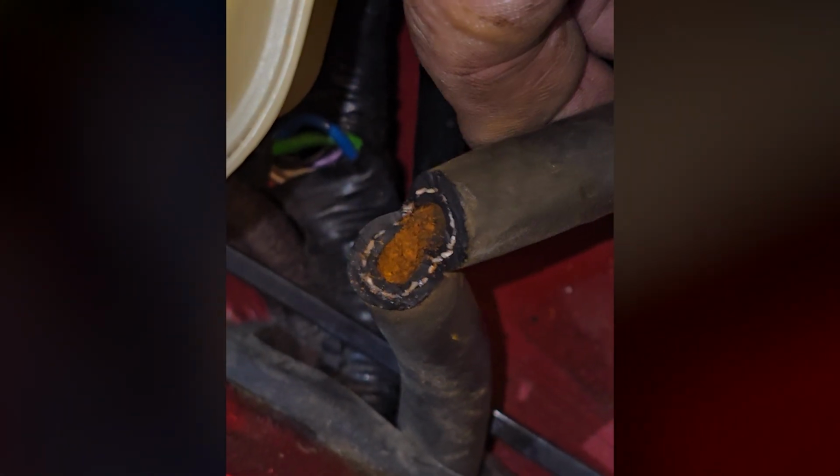And I did get back one time, and it was steaming a little bit. Now, we found a couple things in that. I'll show some pictures here. Like I said, I don't want to go too deep in this. We're going to do a little exploratory thing about what led us to this and what we've done so far. But essentially, I found the line to the overflow tank was clogged with this muddy, dried up coolant stuff. I don't know if someone tried to put stop leak in it at some point or what.